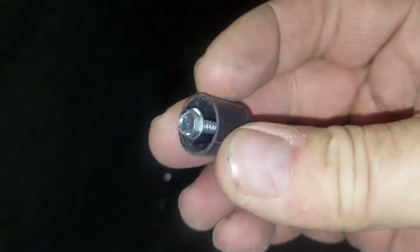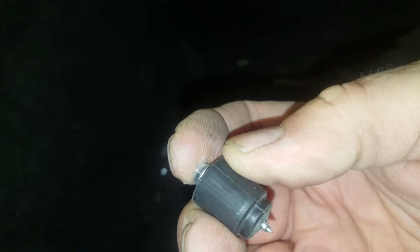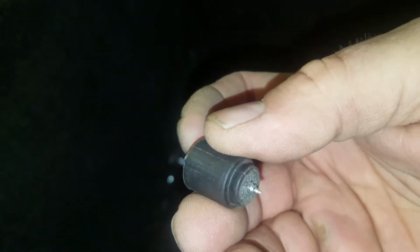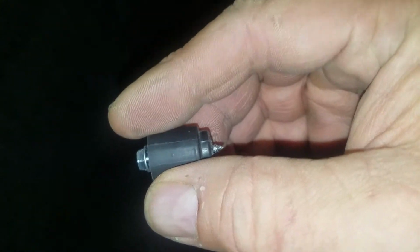Again, what I did to that other piece is I drilled a hole through it on the drill press in the center and ran a screw through it. On the end of this, I put on JB Weld, the black and white stuff that turns to gray when you mix. Don't use the clear. I tried it first. It stayed too flexible. So the regular old JB Weld in the squeeze tubes where you hand mix is probably the best.